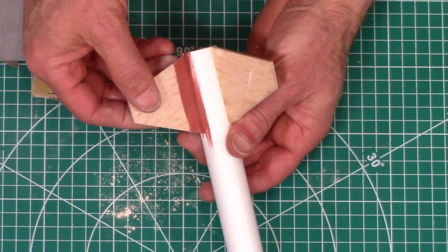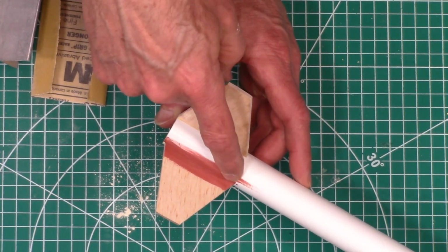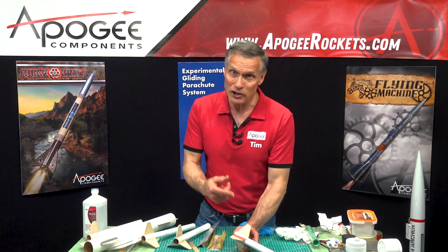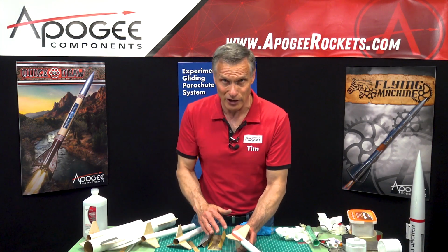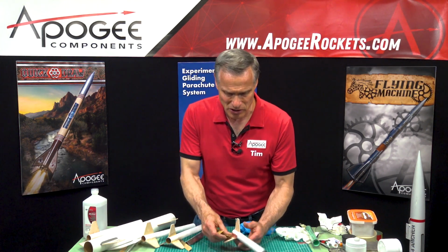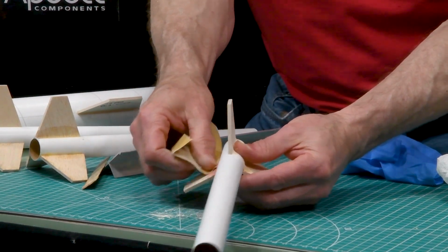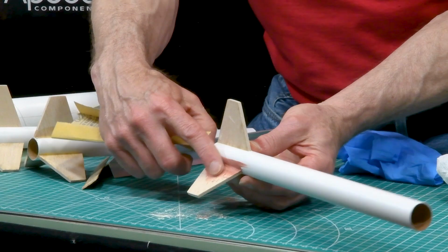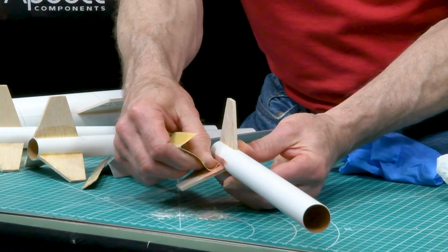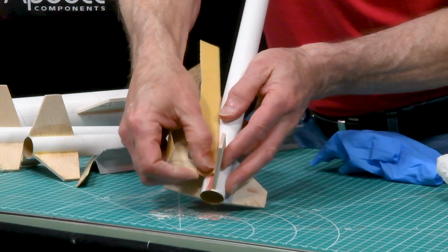This is the Bondo putty. This I put on thick, and I don't know if you can actually see it, but it actually cracked. As it was evaporating out, it left a crack. And so to fix that, you just put in another layer on top, and then it will fix that crack. And again, this stuff sands nice. When I say nice, it creates a lot of dust. You can see all the dust that's coming off of there. And you can feather out the edges really nice. And you can do that side and do this side.